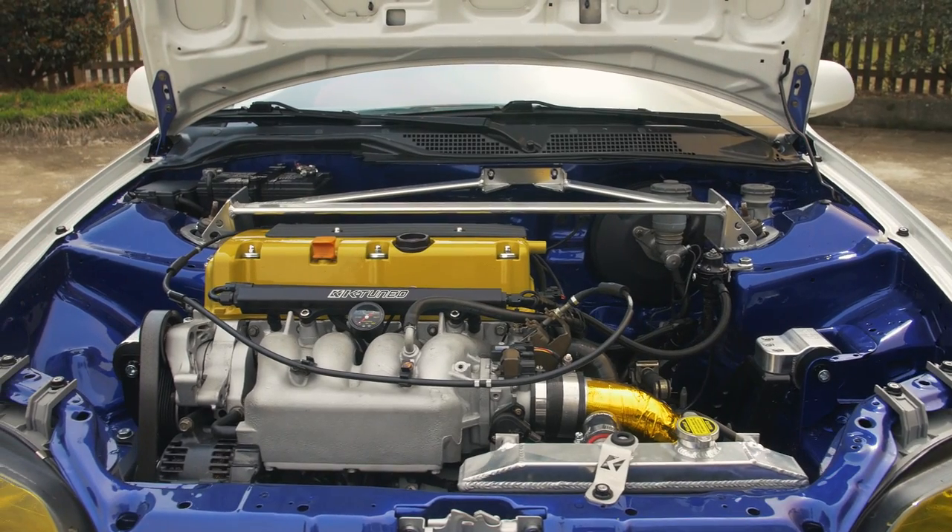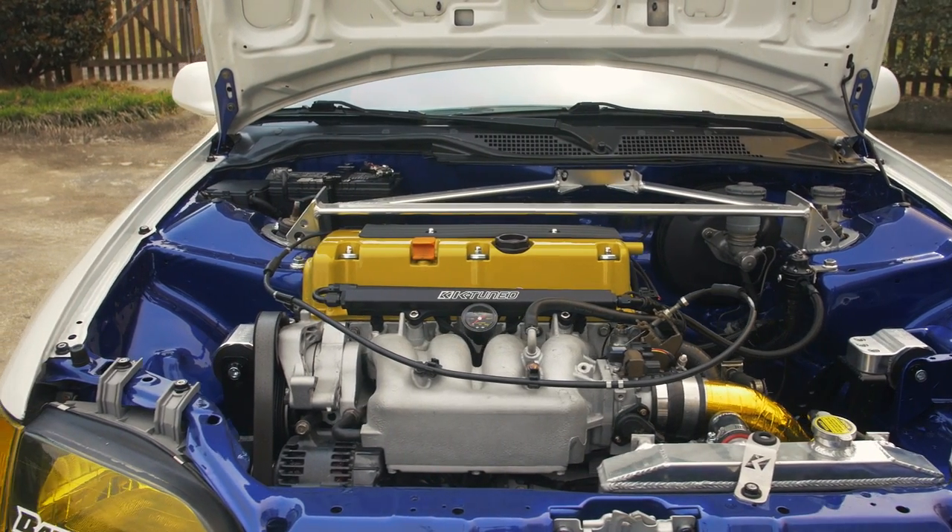So this is like a full stock experience? I didn't know that. I thought you would have to use K-Pro or something. Well, the reason you use the JDM Type-R ECU is it doesn't require an immobilizer, so it'll plug right up and work. That's insane.